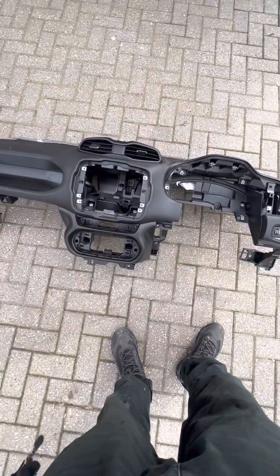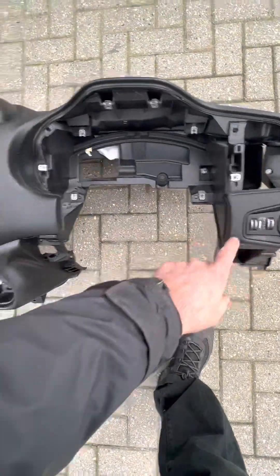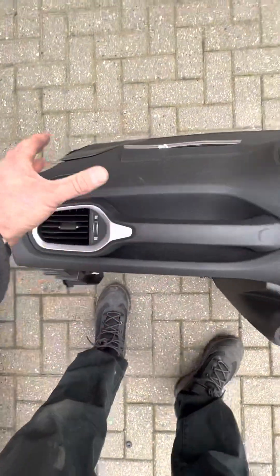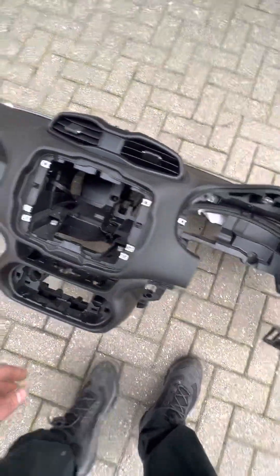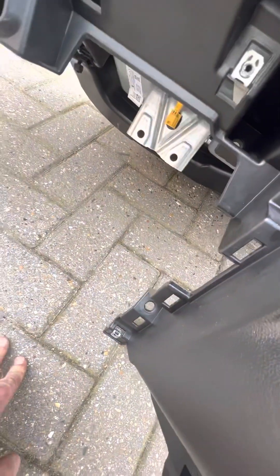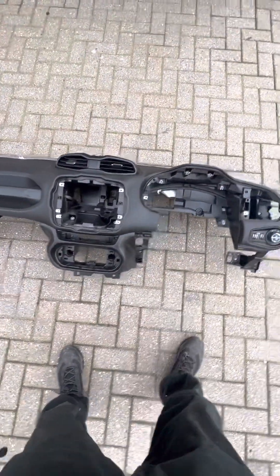Wire and wires — it's not too bad. A lot of the wires are for the stereo. You've obviously got a wire to that. There's some wiring for the lighting in here, and when you do pull it out, there's a wire for the speaker here and a wire for the speaker here. There's two bolts here for the airbag — that obviously goes onto the frame. There's a wire to that airbag as well. It's not too bad — you can kind of get it out about a foot from the screen, undo those, and that's pretty much the Renegade dash.